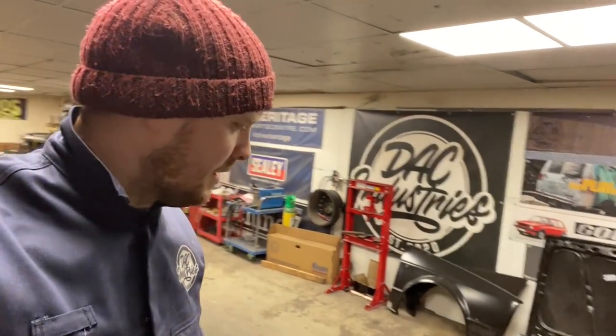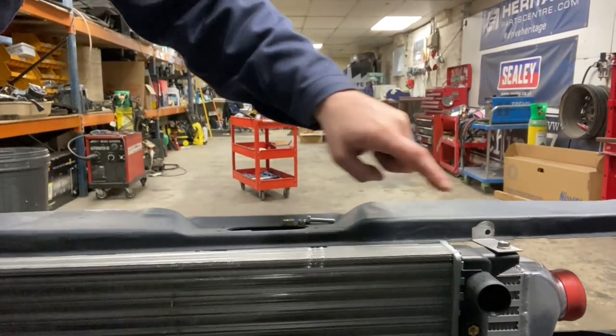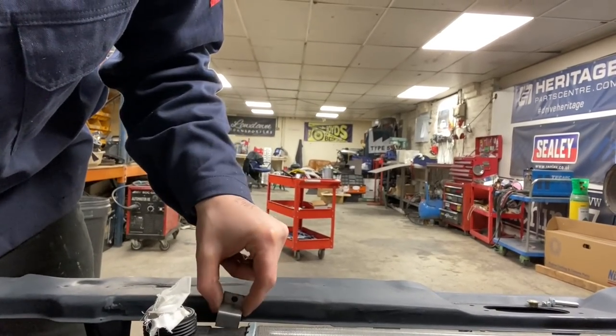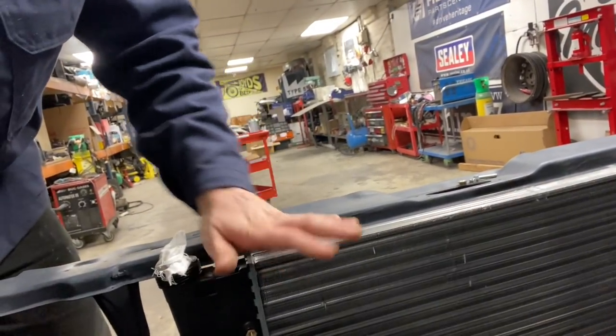Next thing that I wanted to jump onto — I'm trying to focus on getting the engine bay and the underside and the wheel arches done, so we can get them seam sealed and then get them gravitexed and ready for paint. I want to try and get that done before Christmas. The next thing we're going to do is this radiator. Originally we've got these mounts that we've made here and here. Where these are dipped in before — which is why that one's so short — but now we've smoothed all this off, I've got a bit more land. We want to make this so that it's bigger and we've got a better fixing to hold that in place. We're going to make a nice new one, and then I want to make a sort of panel that's going to close the top of the radiator off, because it's not the nicest looking radiator. I've got some steel laid out — I'm going to cut ourselves a piece of that, fabricate the shroud first, then fabricate the brackets and work out exactly how it's all going to fit together.